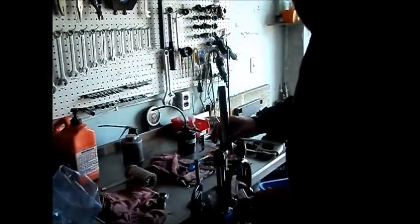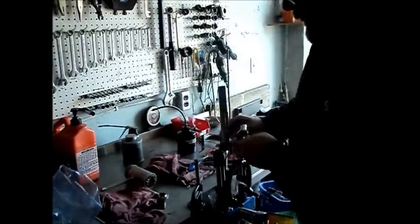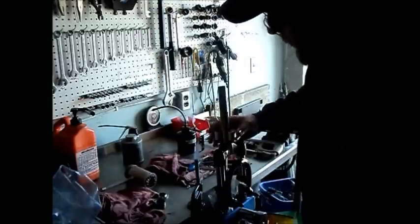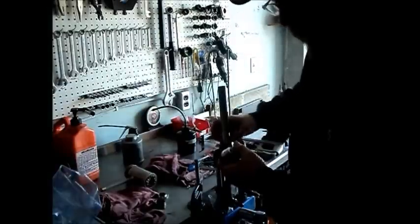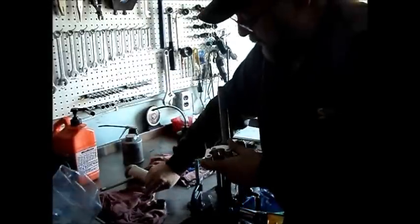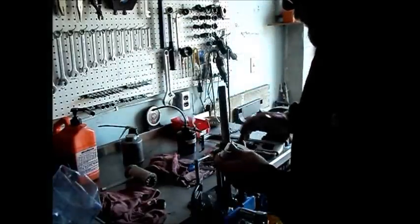Now the seats can be adapted from one size to the other. If you've got the wrong fork — you've bought an ISO but you really need a JIS — which means you need more material on there to have a firm seat. You can actually use a knurling tool, put it in the vise and put pressure on it, and the knurling rollers will actually make indentations and raise the surface, so it will actually increase the effective diameter. Then you can take your milling tool and run it over the knurling, and it will give you a nice solid 27mm from a 26.4. Or if you need to go the other way and you've got one that's 27mm and need to mill it down to 26.4, you just put the other cutter in, flip it around. So a one inch fork, if you've got the wrong one for your application, it can be adapted either way.